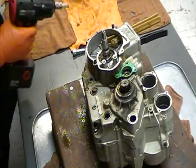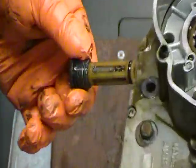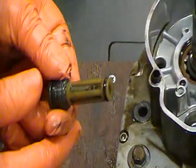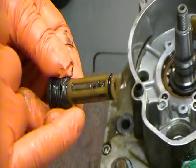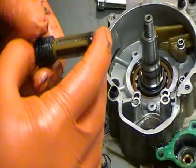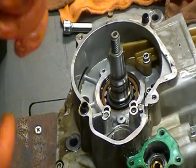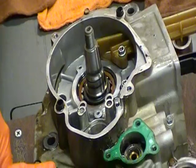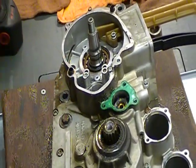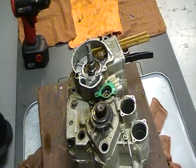This is your crank screen — this is what screens the oil before it goes into the crank area and the top end. As you can see, there is a lot of debris stuck in here. What I'll do is pull all that debris off, lay it on a towel, and inspect it to try to find out what it is. There's definitely something going on in this engine in particular. You can get the cases separated without pulling this out, so I'm going to leave it in — it's in there really, really tight — and I'll show you what that looks like when I get the cases separated.